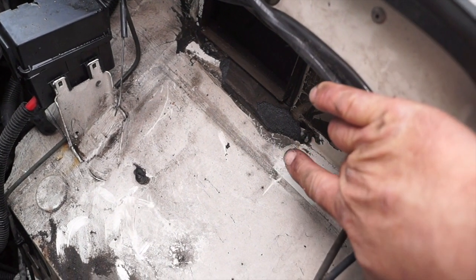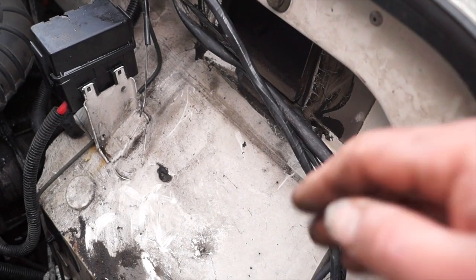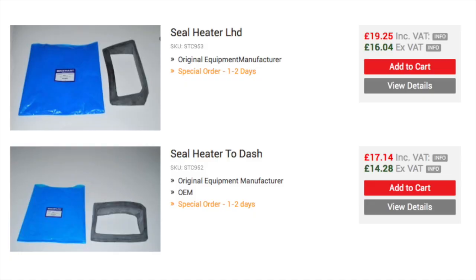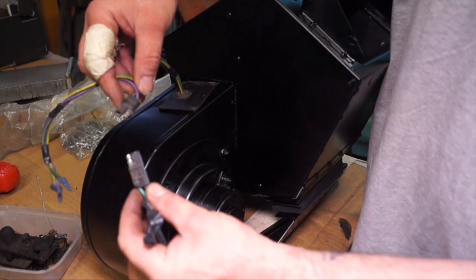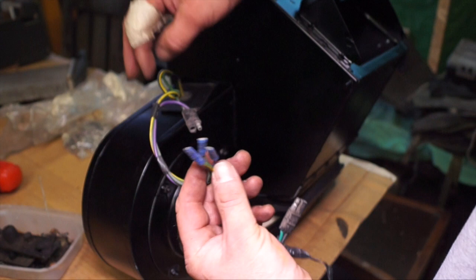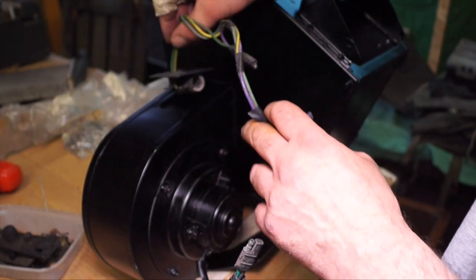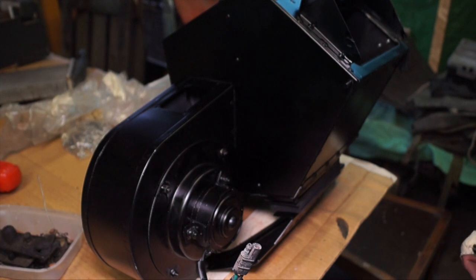Clean the surfaces on your bulkhead and heater box before painting. What's left on the bulkhead can be cleaned off with standard thinners — don't scrape the paintwork too much. Seals are available from places like Paddock Spares for around £20. The old heater matrix goes in the bin. We also need to replace the resistor unit because it doesn't work and it's missing its multi-plug — the devil's work is never quite finished.